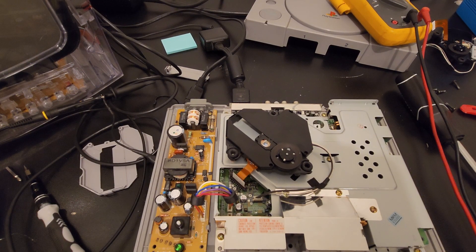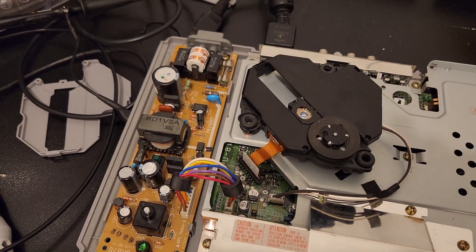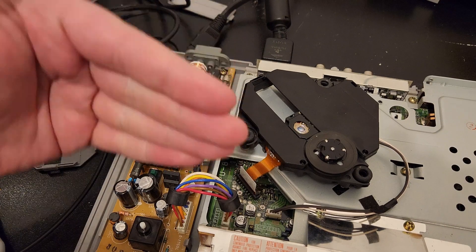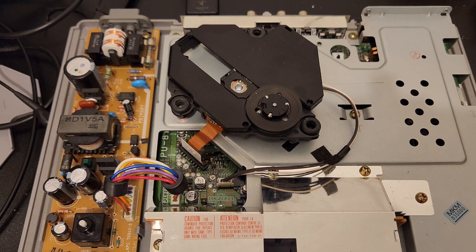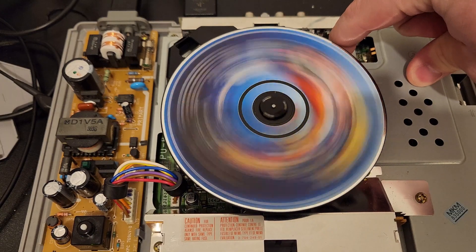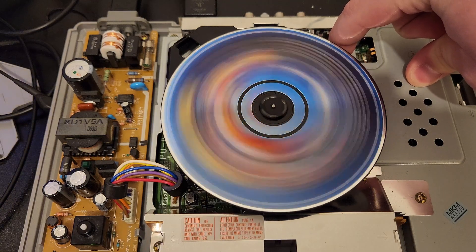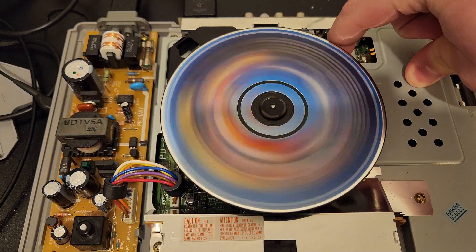So here is where I left off yesterday — today is Sunday. Yesterday I spent probably five or six hours debugging this laser problem. A couple of important things to note when you're debugging this: obviously you're going to have to do it with it powered on. Main things to avoid touching are basically from here back — just don't touch anything, you will shock yourself. What I experience right now with the new laser assembly is I put in a disc, plug in the power, turn it on. It will read the disc slowly at first — that's it reading the region code, so it knows it's a PlayStation 1 disc. The problem is after that, when it really cranks up the speed, it somehow loses signal quality and can no longer actually read the disc.